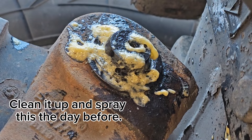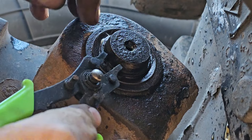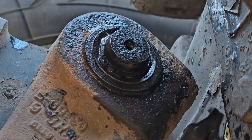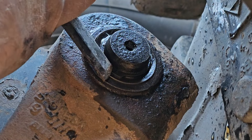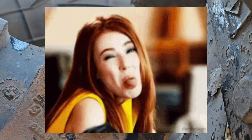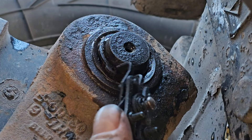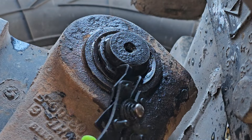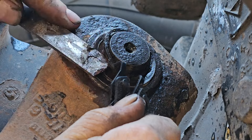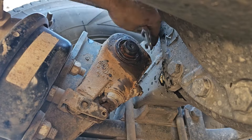I got an old kitchen rag and cleaned it up, then I got my snap ring pliers — and of course they didn't work because they're crappy snap ring pliers. What I ended up having to do was use my wood chisel. I know what people are going to say in the comments — a wood chisel is for chiseling wood — but my wood chisel was shot, so I used it to hammer around the snap ring and free it up. My snap ring pliers just wouldn't go wide enough to pull this thing off the shaft, so we had to bring in the wood chisel and kind of pry it up at the same time. We worked it out. In my case I had to reuse this snap ring because the slack adjuster I bought from Fleet Pride did not include one — it was the in-house brand.